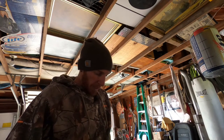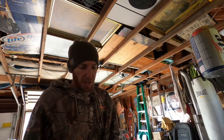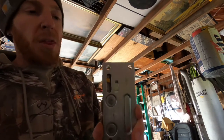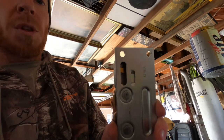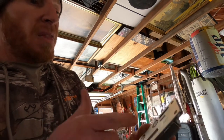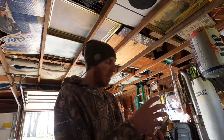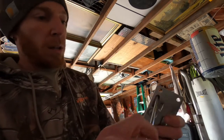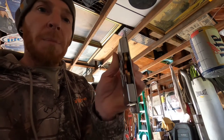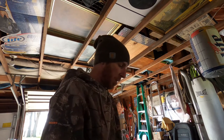Rip this open — it's basically just four screws that hold this thing in, and then there is a little thing in here that hooks to a lever. We'll go over to the truck and I'll show you that. Basically when you open the handle, that thing unlocks. I'll take a screwdriver real quick — see how that popped open there? Fantastic. So that's what's going on with that door, it's all jacked up.